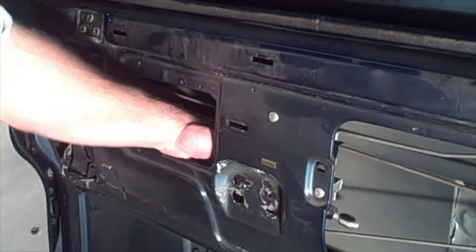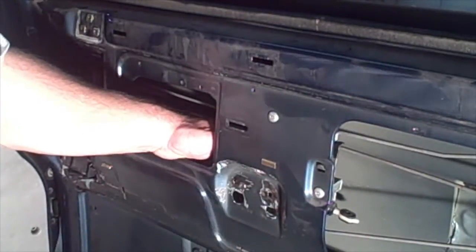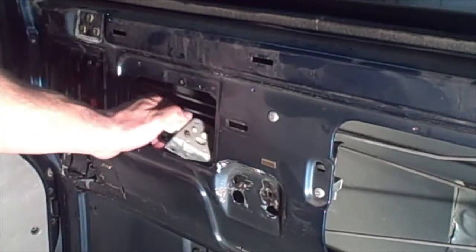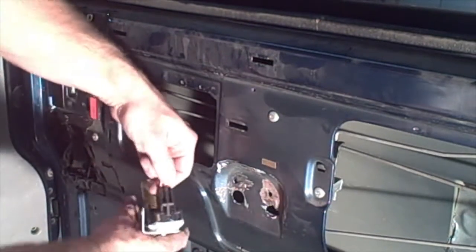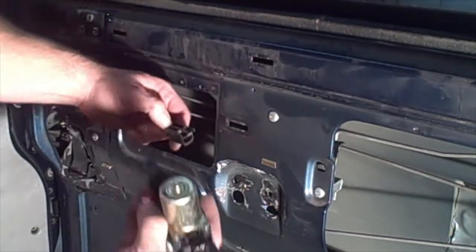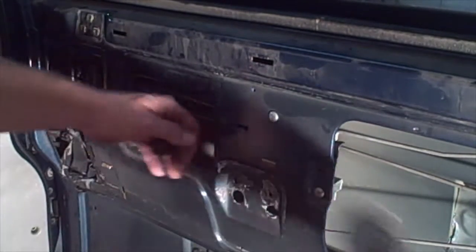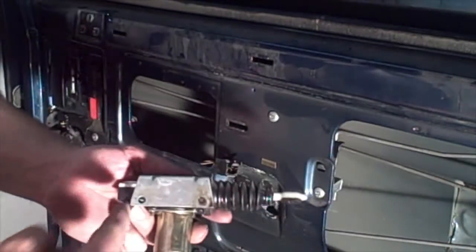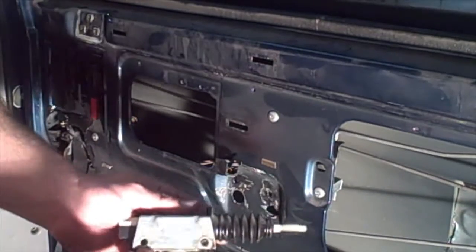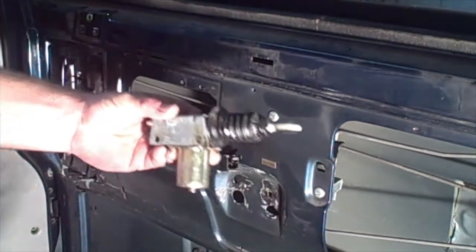Now that we've got this all drilled out — it's not my best option because now I have to paint this and clean it up a little bit because it could rust — but once you've got that ground out, you can pull out your actuator, push this little pin down right here, it pops off, and then the new one just plugs right in here. We'll take and mount it in there, and I'm going to take it over to the bench and show you how to weld on a couple little bolts to the back side so you can just put nuts on.